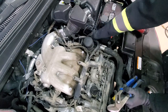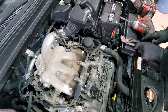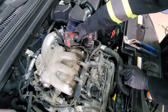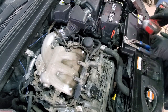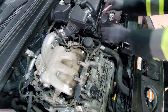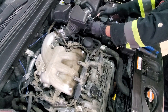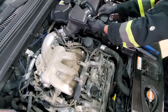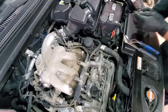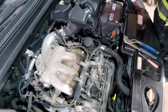Next we will remove the air box, air filter box cover, and the air intake hose. First we will start with this hose coming here, then get the hose clamps loose, then remove the electrical connector from the mass air flow sensor. Actually, let's get the cover off first — it will be easier to undo that connection.